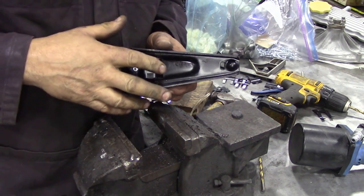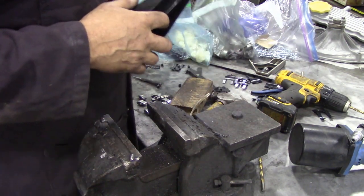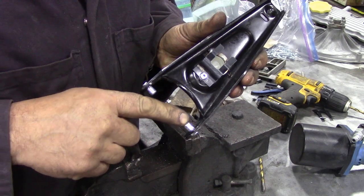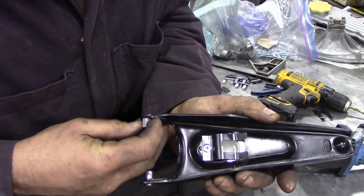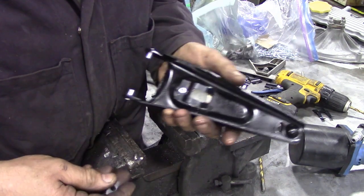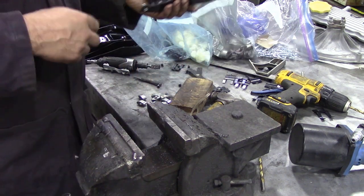I just want to say a big thank you to anybody who has bought the clutch arm. In this following video I'm going to show you how we actually fit the bush. There are one or two things you've got to know before you fit it: you've got to put a little bit of white lithium grease in the ball and on the pivots here, and also on the new clip I've supplied. Unfortunately I can't supply the grease when I send things by airmail — it's restricted — so anyway, let's get on with the video.